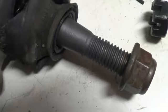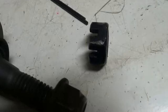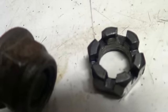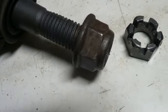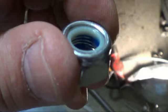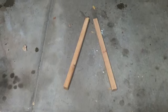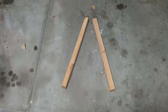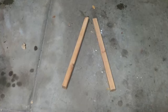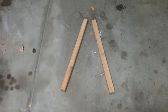This factory one had a coarse thread and a lock nut with no cotter pin. The new one was supposed to have a cotter pin and a castle nut, but because the fine thread's in there and there's just not that much meat, I ended up stripping that out. So off to the store to buy a locking nut and we put a little blue Loctite on it. When they align your car at the shop, they're going to put a little bit of what they call toe-in so the front of the tires are a little closer together than the back — that tends to make your car want to go wherever you point it. But with the method we're using today, it's about impossible to actually get close enough to even worry about that, so just get them as straight as you can.